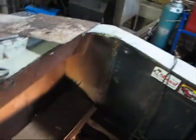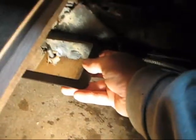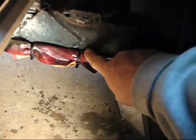I got the first bolt in place. I can see the sun's coming up, so I'll check the time — I want to be at the Department of Motor Vehicles when they open this morning to get myself all legalized as an official driver on the road. I thought I'd show you that bolt welded to the frame with the carriage bolt down through it. I should be able to stick a nut and lock washer on the end of that. I went ahead and wrapped my lines in leather because I didn't want to weld around a gas line or a brake line.